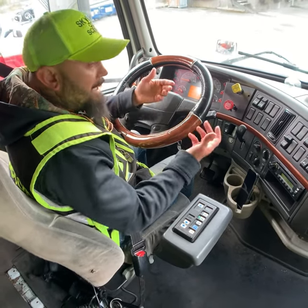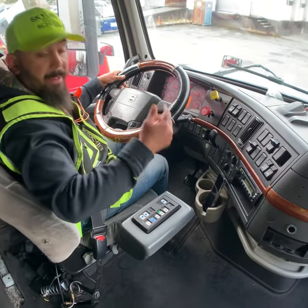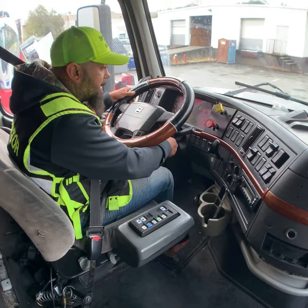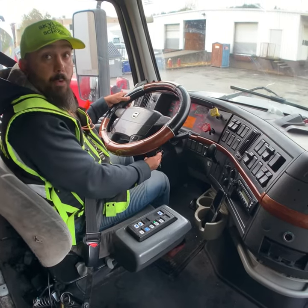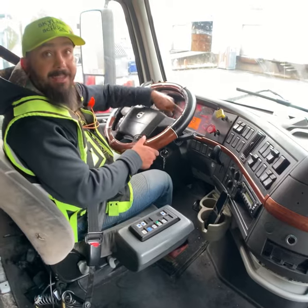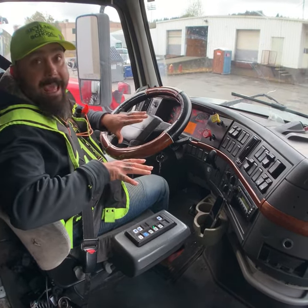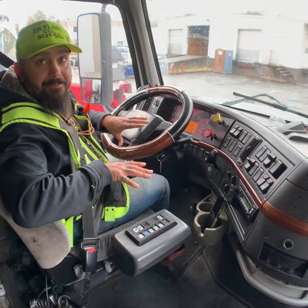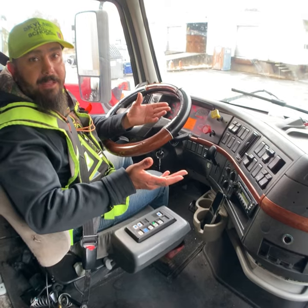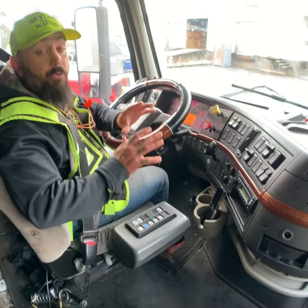After that, B, tractor protection valve pop out, trailer protection valve pop out, and neutral. After that, start the engine. When we start the engine, while air pressure builds, we start our in-cab inspection. It shouldn't be in order, and if you forget something or something is wrong, you won't fail.